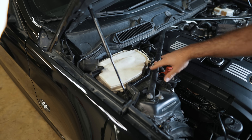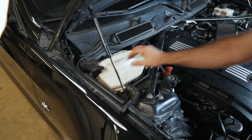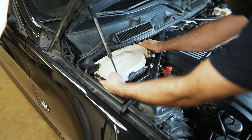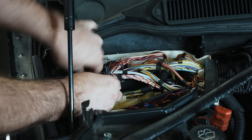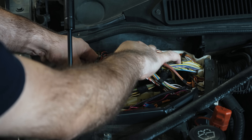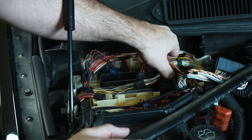If you have your factory cowl, you need to get that out of the way first. We're going to unlock the ECU box — the DME box — pop the clips off, and lift it up. Before touching any connectors, disconnect the battery at the back of the car. With the battery disconnected, lift up on the wiring, pull back on the black connector to eject it from the DME, then remove the smaller connector as well.